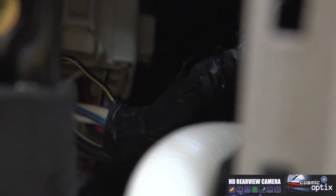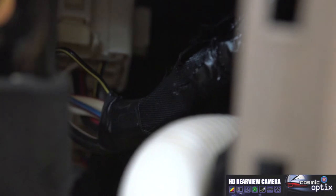We're gonna use the wire right off the ignition switch right here, this white plug that I'm pointing at. We're gonna go up in here and we'll test right inside the plug. So we won't actually have to spike the wires. We're just gonna go in each plug that the wire plugs into. The way we do that is set your voltmeter on DC voltage. And the easiest way to find it is to turn the key to accessory right now, and the way we're going to check it is we should have 12 volts, and when we turn the key off, we should get nothing. All right, so I'm going to go right up behind here and we'll plug right into here. I'm getting 12 volts right now.